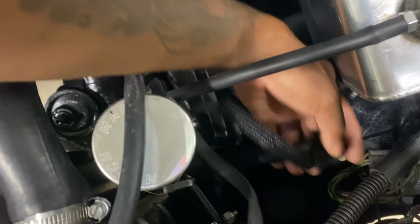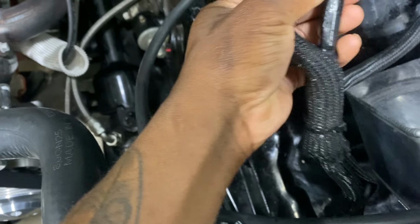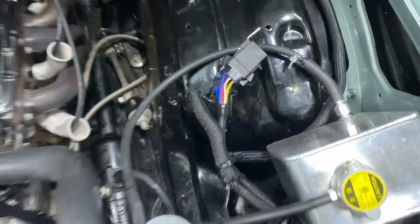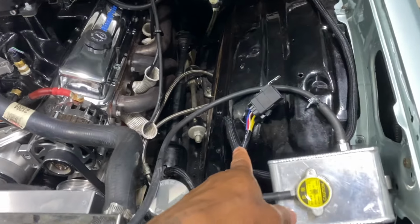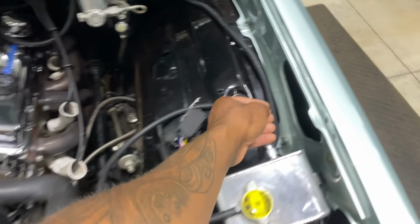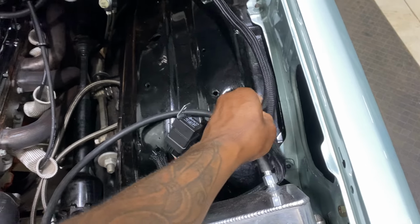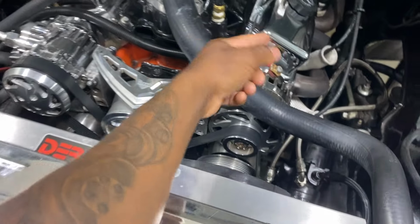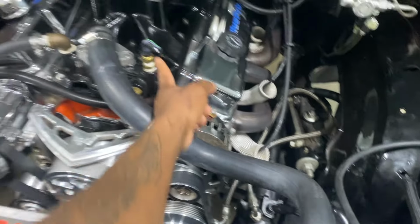These relays here are some car alarm relays. All this is CCA, so it's not 100% copper wire. I'm finna get all that out of there and wire it to the Holley. These are the signal wires for the Holley. So we ain't putting no switch on the motor. You ain't got no input for a switch anyway, because you got the Dakota here, the Holley there, and in the back, I don't think there's any space for it.